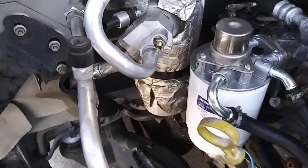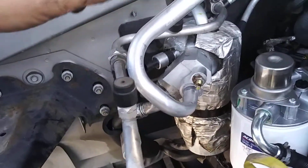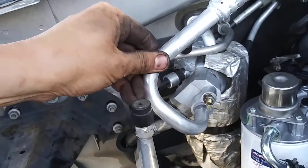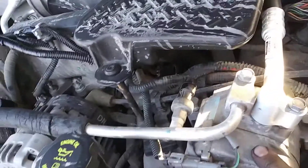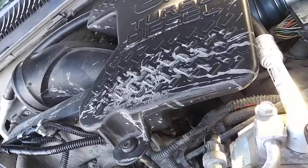You could use a dryer assembly from the ambulance package cabin chassis Duramax — it's a factory GM part and it has this fitting routed out of the way so nothing interferes. I will link to the part number in the video description. This hose is also the second part you will have to buy new; it goes straight into the AC compressor. That part number will also be in the description, and it also came from the ambulance package.